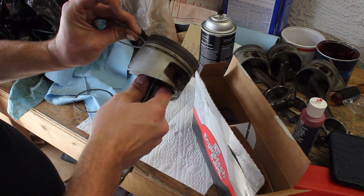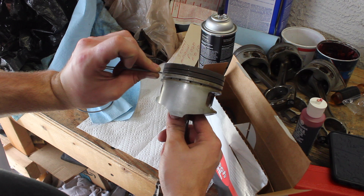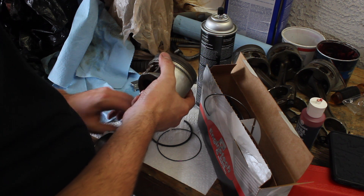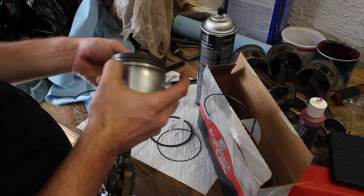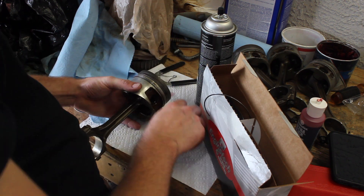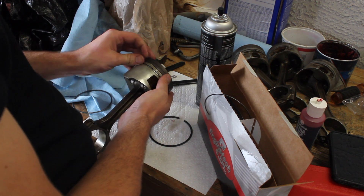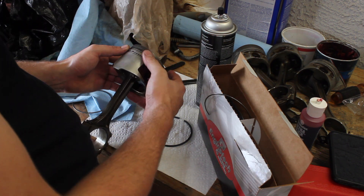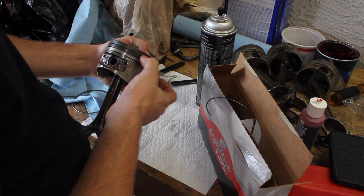You can tell which ring is which by whether it fits in the groove or not — if it doesn't fit in the groove it's most likely going to be the bigger ring on the bottom. It's a lot easier just to put on these rings first. I always put on the scrunchie-style oil ring first and then put on the lower oil rings — these are really easy to move so you can put them on by hand. Just make sure you're not abusing them too much because they can break. I was worried that putting them on by hand might affect their rigidity, but I figured this is a good way to find out.